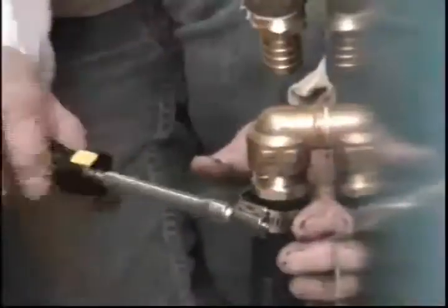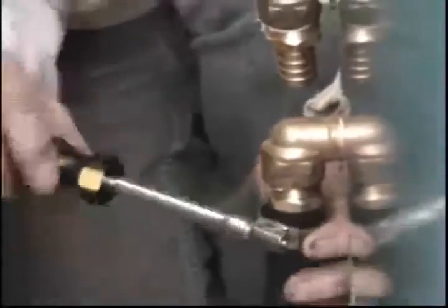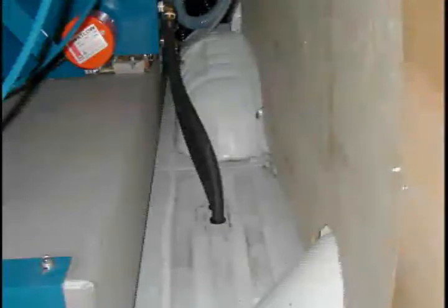When routing the heater hoses, start from the engine compartment, down the firewall, along the frame, and up through the holes in the flooring. Secure the hoses to the insert fittings on the side of the tank. Make sure all fittings and clamps are tight. Check to see if the grommets are secure and there are no kinks in the hoses. Use tie wraps to secure the hoses in position.